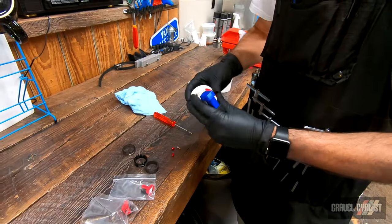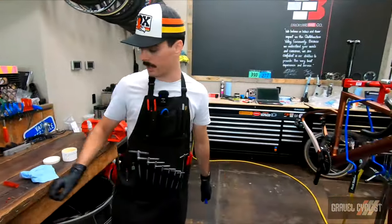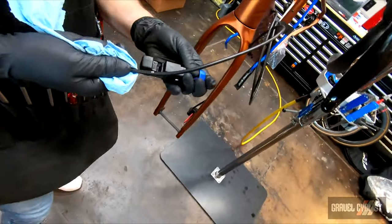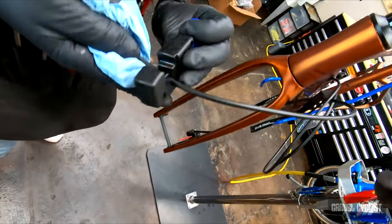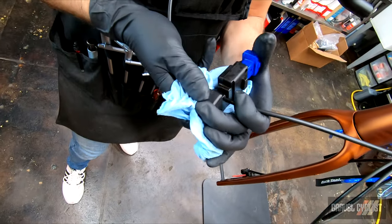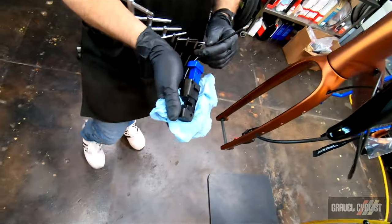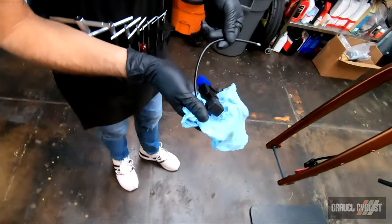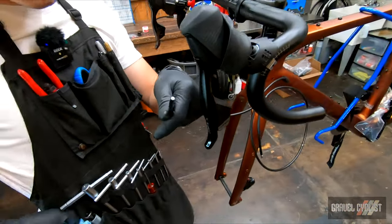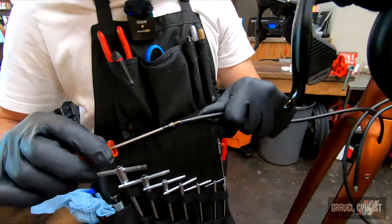The customer was freaking out about getting his custom bike delivered on time, but it was just an easy fix. So I've got my mark here. I've got my SRAM brake hose cutter. We may have some fluid leak out here, so I'm going to hold it with a rag. Cut it, throw that little bit out, and we've got our hose — it's cut nice and flush.